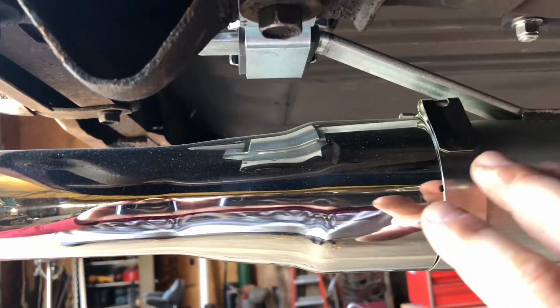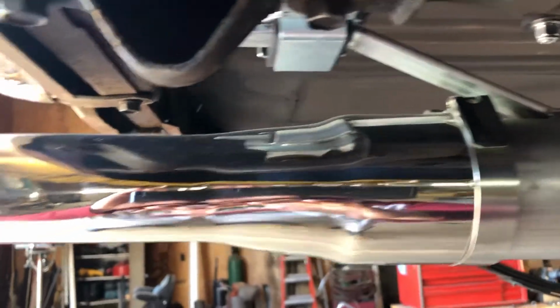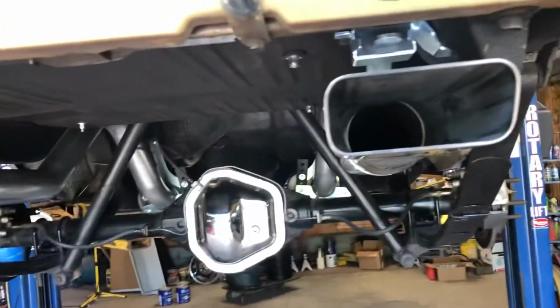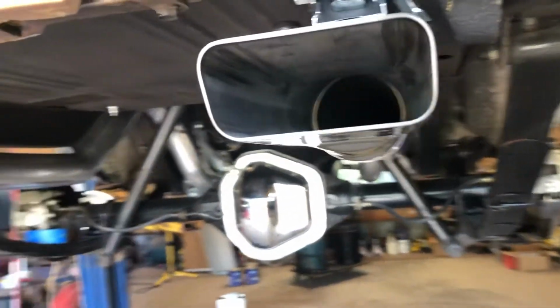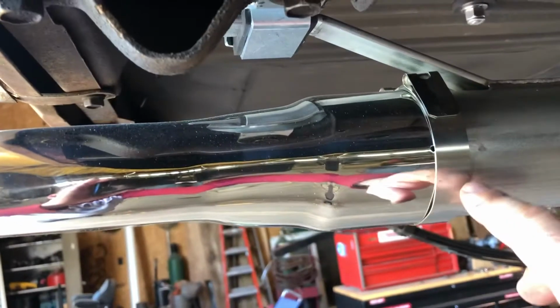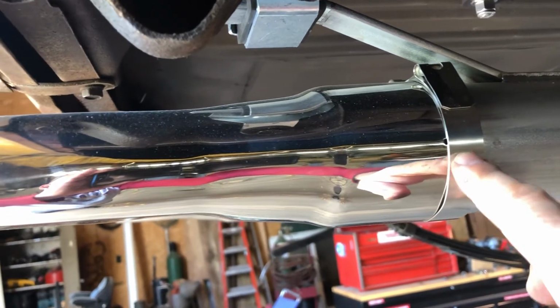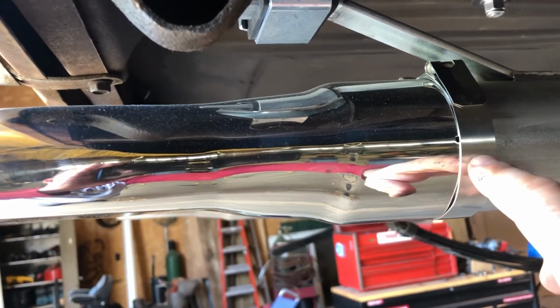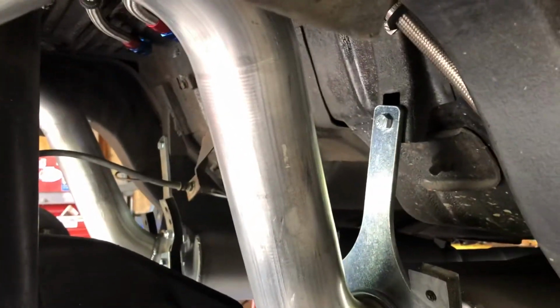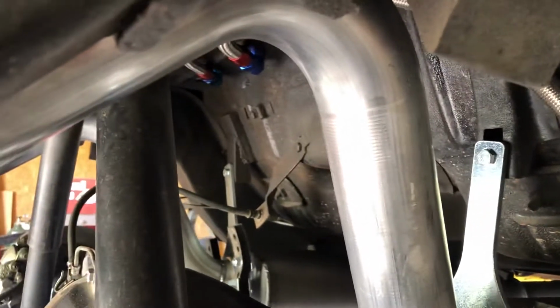So once you get them all adjusted in and out and then leveled, you basically put a straight edge on the bottom, or a level from this one to the next one, get them squared to each other and in and out correctly. Then you punch the little holes out with a drill, and a tiny little stainless rivet goes under this. It's got a little flat mushroom head, so the tip can't come off or rotate. It's pretty cool. We had to make that hanger over there to match this hanger because this was a single exhaust car. So that's that.